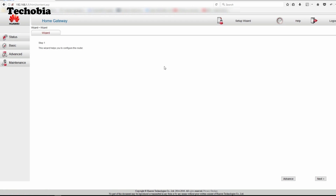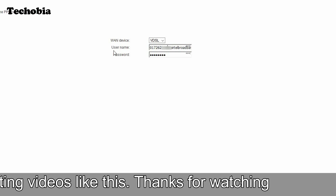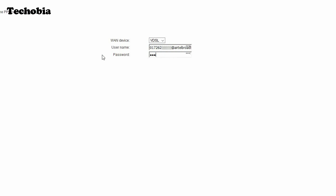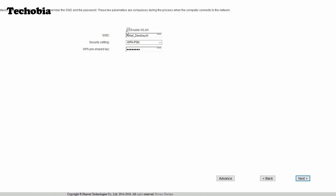After logging in, the setup wizard starts automatically. Select VDSL, then enter your VDSL username as provided by your Airtel representative. Note that Airtel doesn't want you using your existing modem, so they require a call to activate. You also need to append underscore DSL at the end of your username, and your customer ID is normally your password.